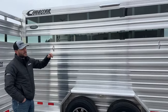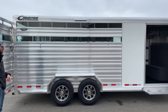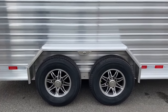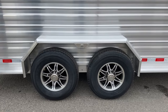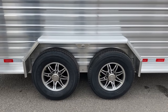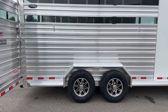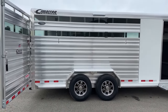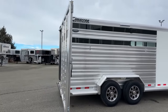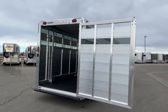Two tie rings front and rear on each side of this trailer. It is 6'10" wide, so we have our full-length running board. We are on two 6,000-pound Dexter rubber torsion axles with nitrogen-filled tires, so you're not going to have to worry about cold mornings and warm afternoons changing the PSI too much. These tires are warrantied through Lion's Head — you will get a one-year no-questions-asked warranty. Any Cimarron you order comes with a three-year bumper-to-bumper warranty and an eight-year structural warranty, and they really stand by it. You don't have to have it fixed at a Cimarron dealer — no matter where you're at in the country, call them and they'll get you taken care of.